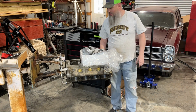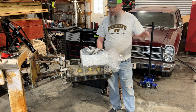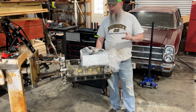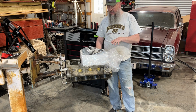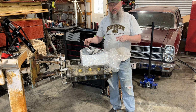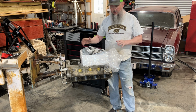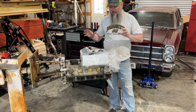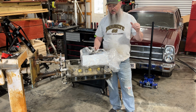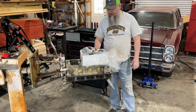I appreciate y'all watching. Follow along as I put this thing back together. It's going to be a series of videos, and we'll try not to make them too long. First thing I'm going to do is get my crank in here, get my studs in here, my main studs, get my crank in here, and get it torqued down right and check it. Then my next video after that one is going to be putting one rod in and checking for my piston to valve clearance.